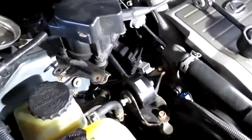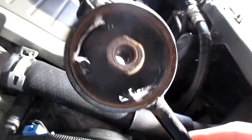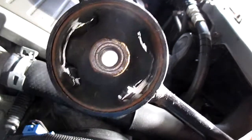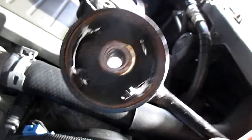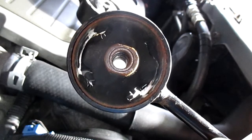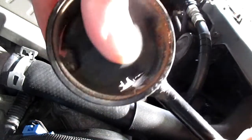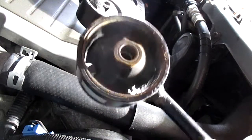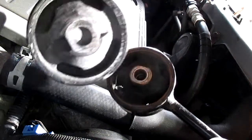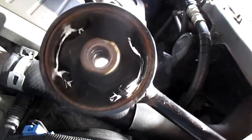I'm going to go ahead and take the two last remaining bolts out. I got the old mount out — as you can see, it's pretty chewed up. It's not completely broken like some of them are, but there's a lot of flex in here. I was getting some engine vibration, not a lot, but basically coming to a stop when in gear you could feel it vibrating more than it should. In Ohio we go through a lot of freeze-thaw cycles, and this is all rubber in here, so generally it's just going to break down. The new one looks solid — you can't see any light through it except through the center.